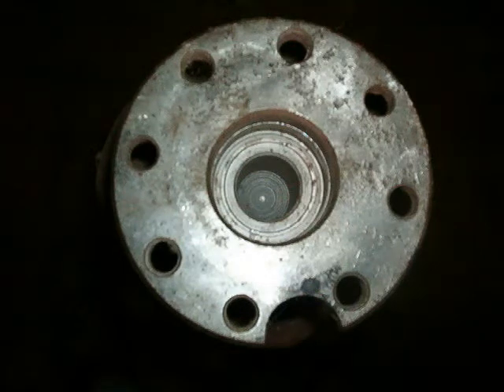This was an unpleasant surprise for some people who decided to convert a car to a manual transmission, especially if they were planning to use something like a New Process A833 four-speed. If the crankshaft hadn't been drilled and the engine was still in the car, about the only option was to try and find a bearing that would fit in the outer register hole and had the right inner diameter for the input shaft. Then the nose of the transmission's input shaft would have to be mostly cut off so it wouldn't bottom out in the crankshaft.